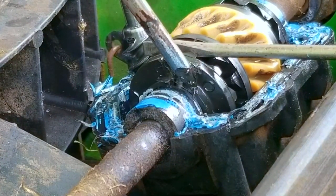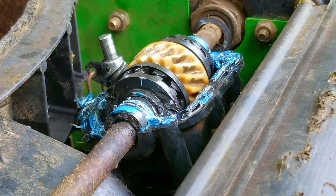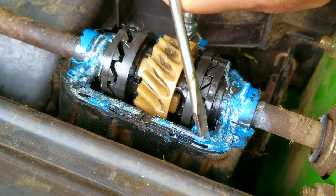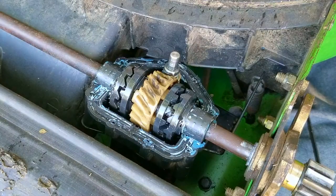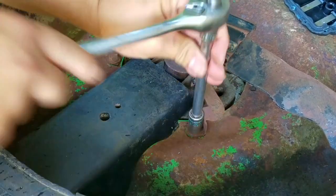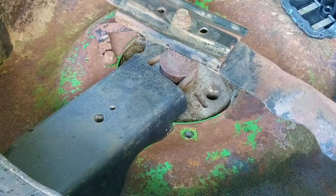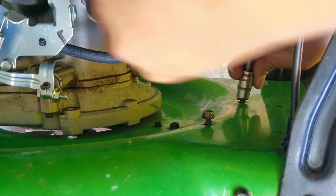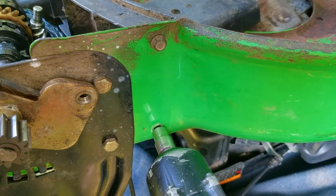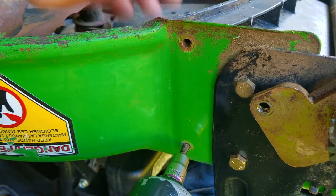It looks like it's working like it's supposed to, so now we have to clean all the sealant off the mating surfaces. I'll do the best job I can but it's going to take a lot of time. After cleaning, the new sealant should take care of any bits I didn't get. I wasn't comfortable sealing it while still on the mower, so we're going to remove the entire assembly. Since the dirty oil leaked out of the top seal I wasn't sure if it would do it again, and if we needed to replace the top seal we'd need to remove it anyway. There are a lot of plastic guards to take off to get the room needed, and since I'm doing this upside down some of the images you're seeing are obviously upside down.